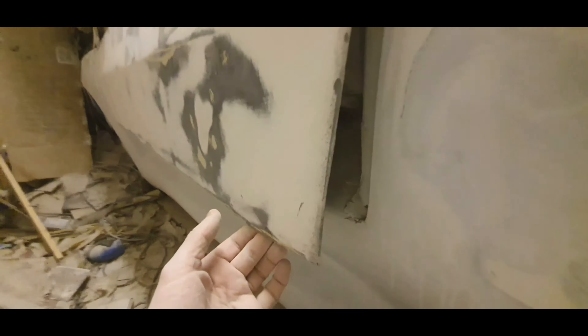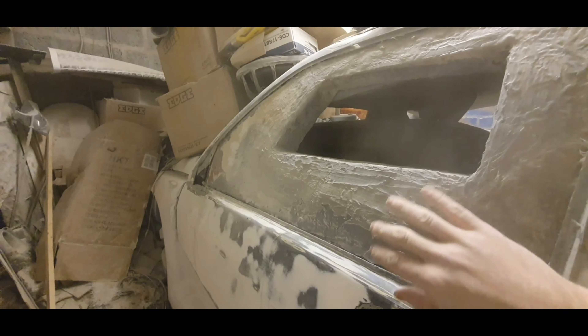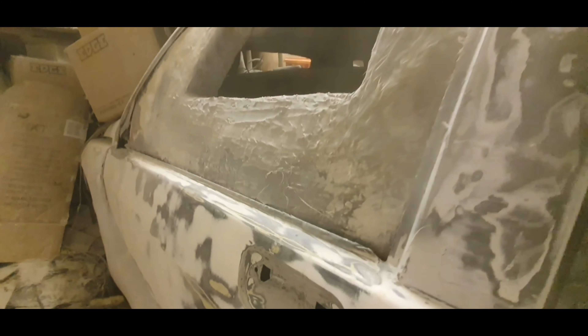For anybody who hasn't seen any updates and is wondering what that is — that's the window, obviously. There will be a cover over this; people have asked before. There will be a cover so basically it'll look like a normal window. This section here will be flatted back, fiberglass again on top of this filler, and then basically there's going to be a panel of perspex to replace the glass in the normal position. I've left all the gutter in for the windows to go in, so it'll slot near enough straight in there. It won't be removable — it'll stay in there the whole time. The original rubber will go back on.